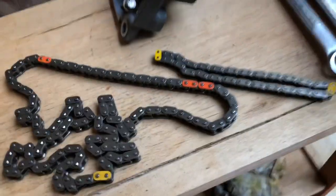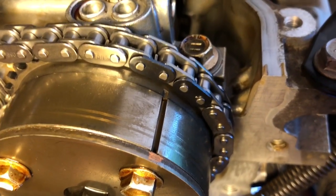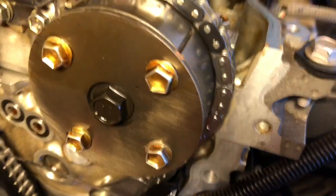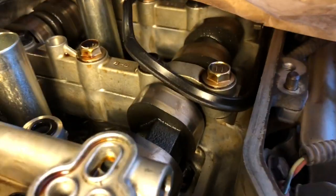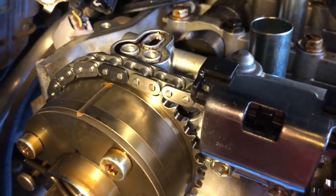Here's the original chain in roughly the same position. On the intake camshaft, there are two discolored links right there, and they go right over this line. In our case, there's a little dot of paint on there, and also a little mark right there between the two bolts pointing up, indicating the correct timing mark.